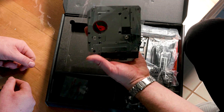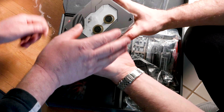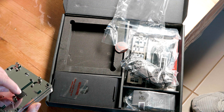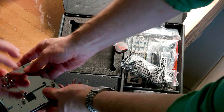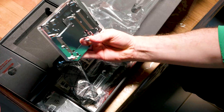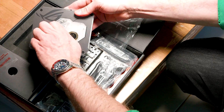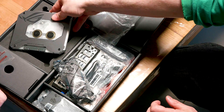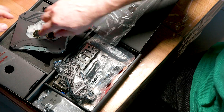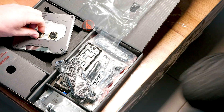So this is actually made by Bits Power — you can tell by the dragon logo, that's Bits Power. This water block is made by Bits Power. So what would you need to use this? You need some fittings and some pipe. A reservoir — EK will fit this. The connection size is quarter-inch, so pretty much anything that is quarter-inch will fit it, including all-in-ones.